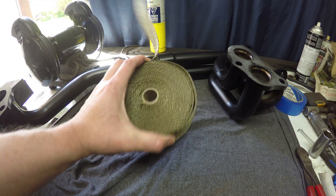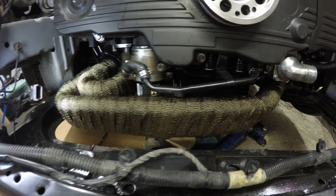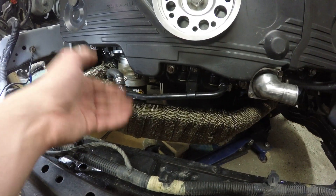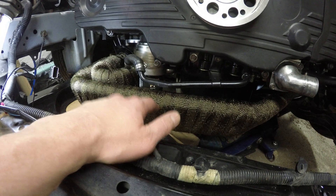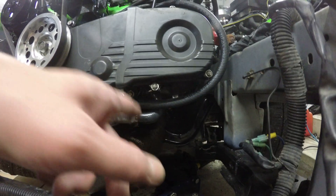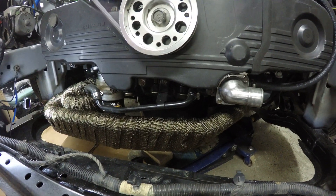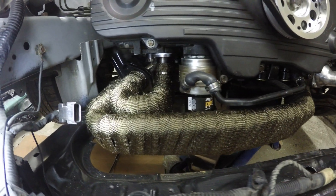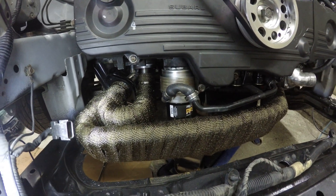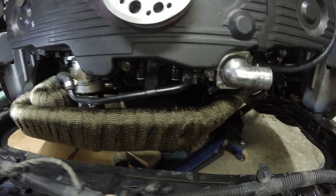Finally getting to this point — it was a little bit more than I had intended. I initially wanted to weld those split joints anyway and paint and heat wrap it, but welding this flange over on this side did add quite a bit more work. Now that it is done it's a perfectly aligned bolt-on header, so there are no issues with the lineup, which really means it's probably never going to crack as long as my welds hold up.